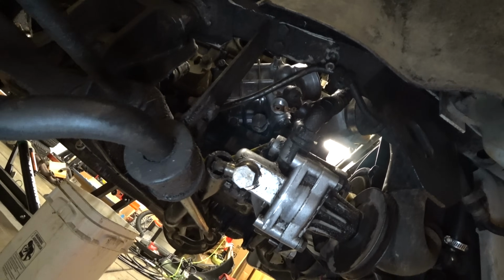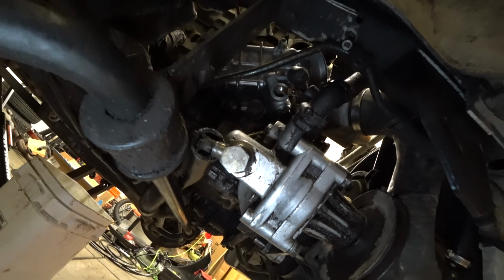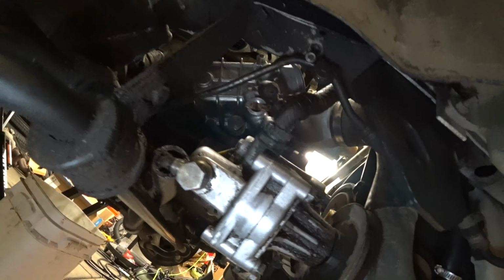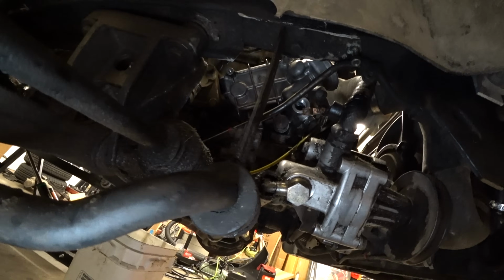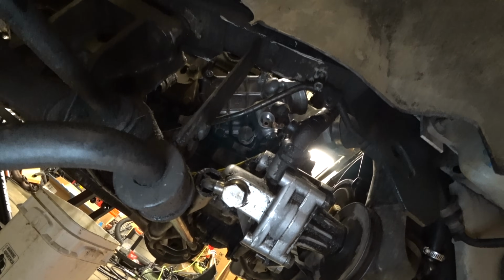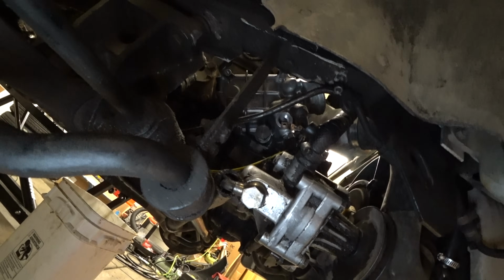And the oil pressure relief valve alignment tool is out, and as you can see, I've got the oil pressure relief valve itself started. The housing is torqued to 20 Newton meters, and now I have to get my, I think, 21 millimeter socket back up in there and tighten that thing down. And I'll tell you how tight it has to be. But it's finally, you can see the light of day here at the end of this job.